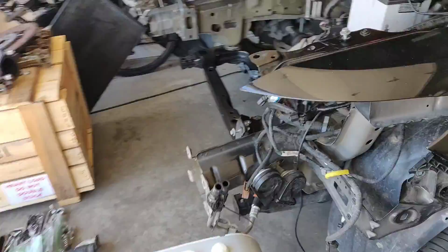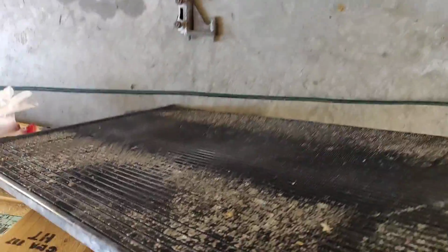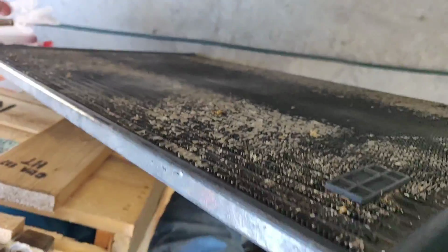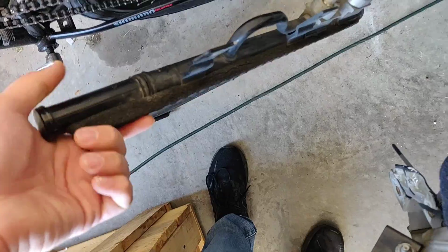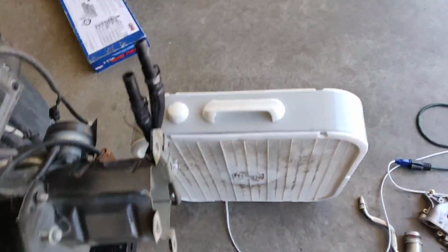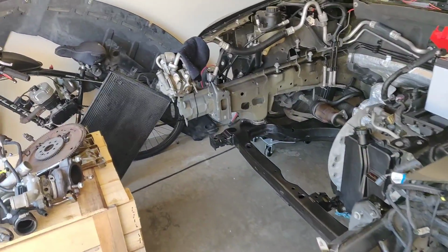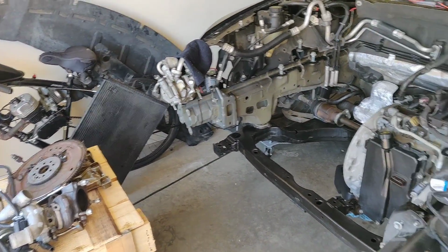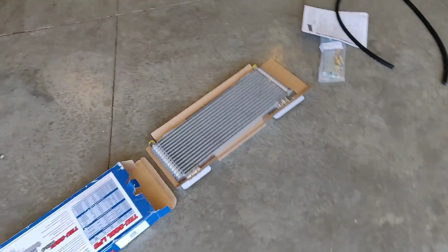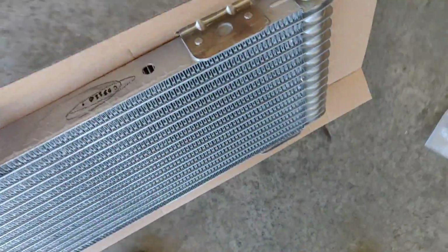Normally, performance pack ones have an auxiliary cooler that goes to the front of it. And as you can tell, my transmission cooler part of this is actually beat to piss. So what I've been thinking is, if I were to do this and remove the AC, and that would in turn remove the transmission cooler, and I don't have the auxiliary one from a performance pack, and then just run this instead. So I'm going to take a little bit of a comparison here.